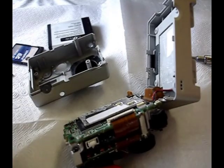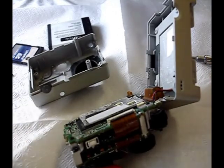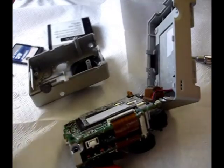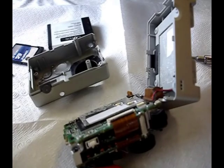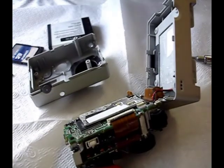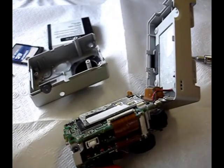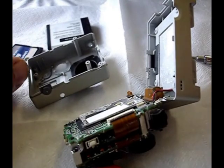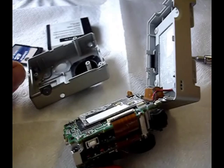If you don't see any moisture, use a hair dryer on low for about a minute and a half. Hold the unit in your hand so you can make sure it doesn't get too hot, and blow into all the different areas on it. Then put the camera all back together — the same way you just saw me take it apart, just in reverse — and it should work.